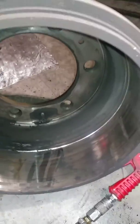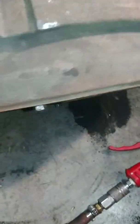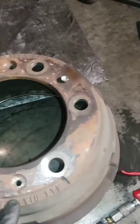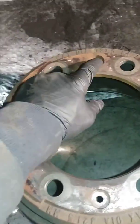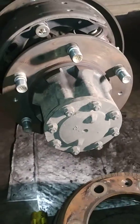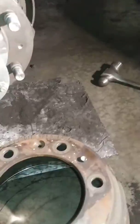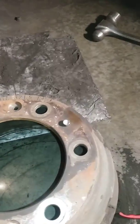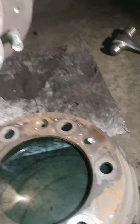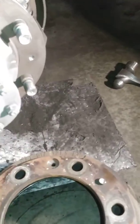They didn't want to budge. I'll show you a little trick. These two screws that hold it here — there and there — hold the drum on when the brake shoes are loose. Those two screws actually go in these holes, which push it about an inch off the plate here.